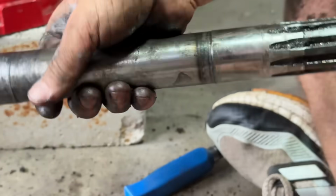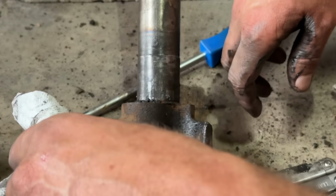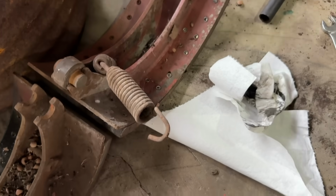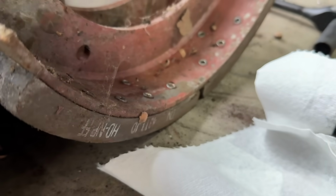So we have to get our serial number off the truck, call someplace, run to Dallas, get some parts. My brake shoes look excellent, and they're like that all the way around. You can see on this truck, if you look inside the drum, the brakes are in really great shape. They just needed an S-cam and they didn't notice, or they just didn't have the money to fix it.